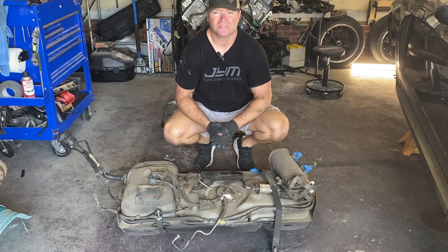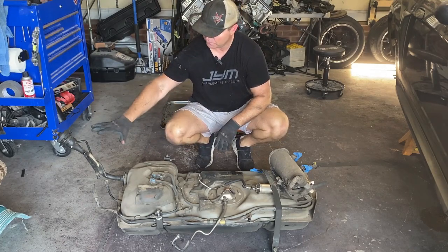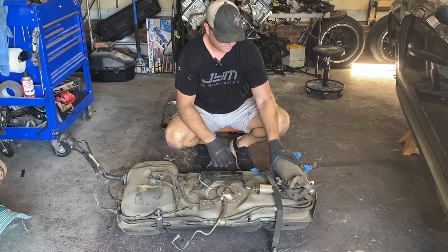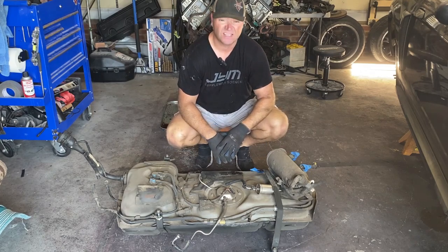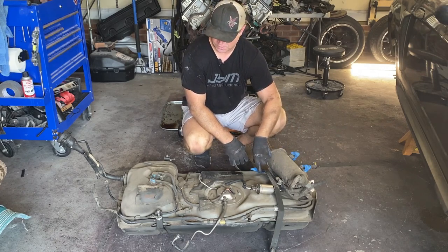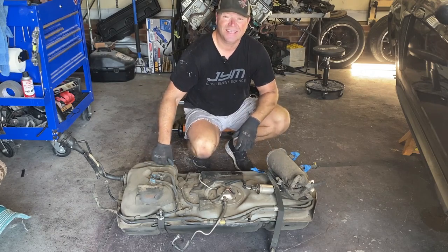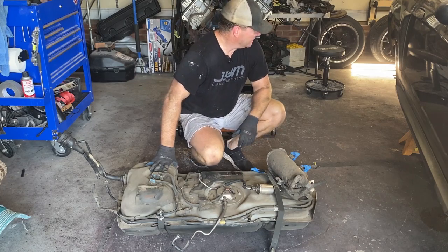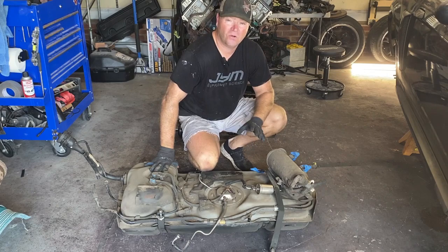Here are the bounties from this episode. We've got the fuel tank out, the fuel filler out, took the fuel filter out even though we'll get a new one, and the evaporation canister. Just a couple of notes: remember any loose screws — tape them on like the pin we showed on the strap — and try to put as many of the bolts back as you can. You've got the fuel system out. Next is really the absolute last piece on this car, and that's the rear end.